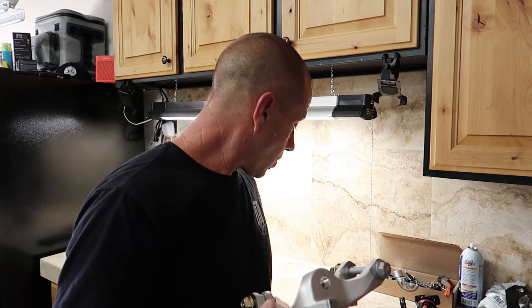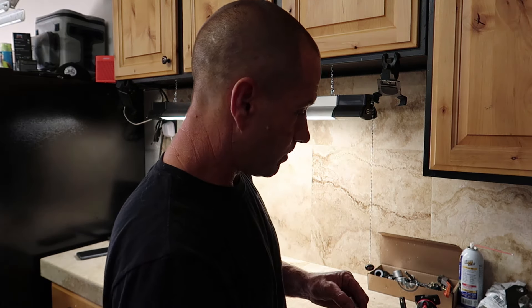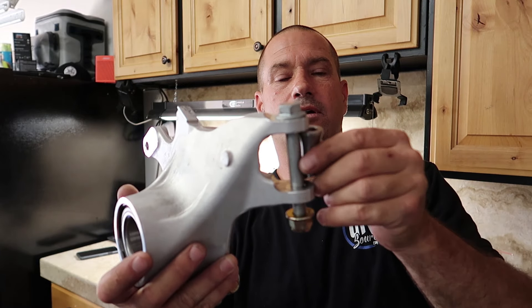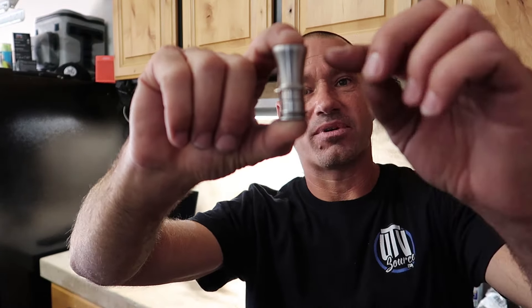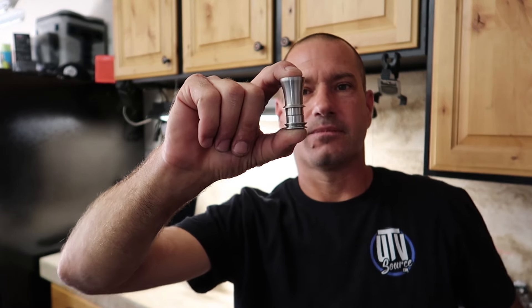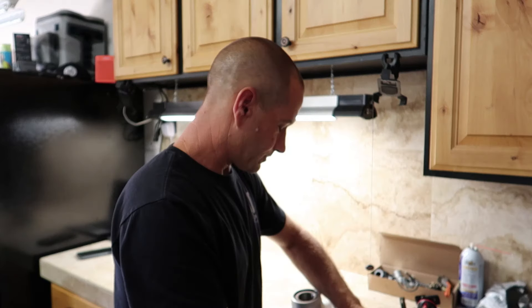What Shock Therapy has done is pretty simple — it lowers the tie rod angle, brings it down, takes it out of center. Your factory setup is dead center, and you're going to this new angle. What it does is bring that tie rod down so when you're cycling through the range of motion, your hub isn't getting pulled left to right. This little ingenious part is just a misalignment spacer — that's all it is, nothing crazy.